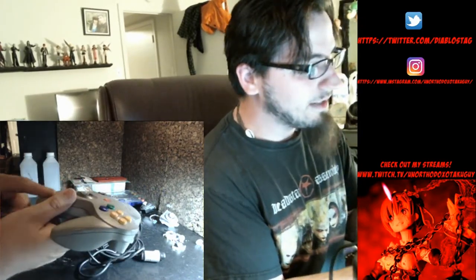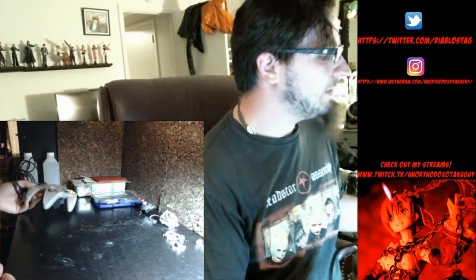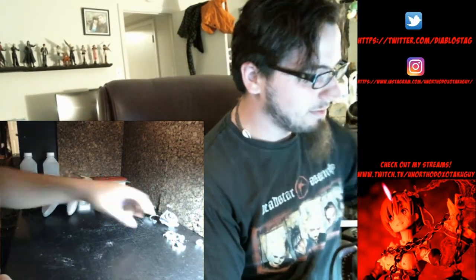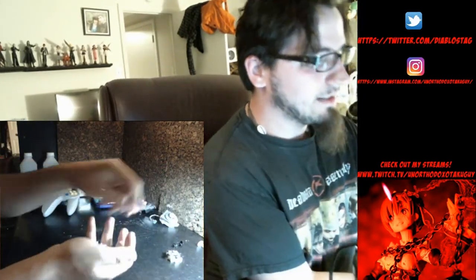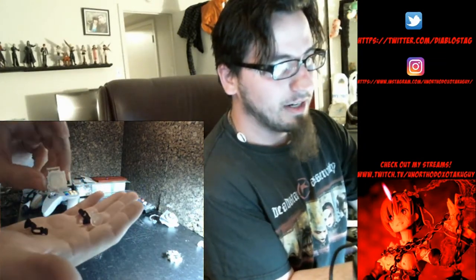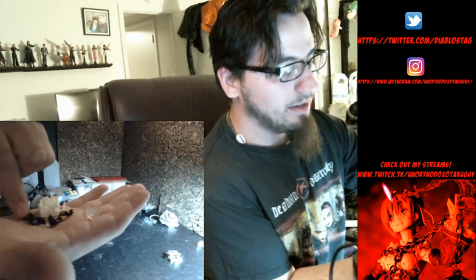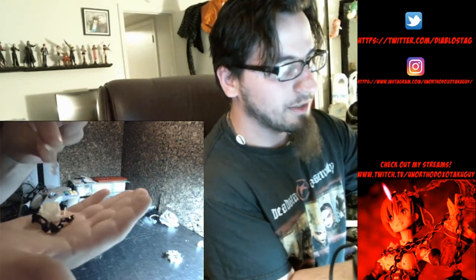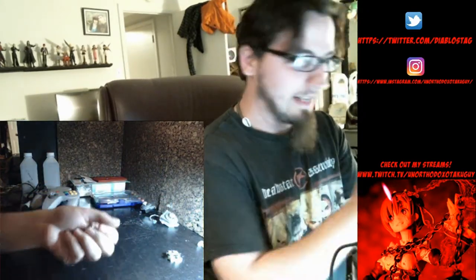And I actually see the residue on this controller that I need to clean off still. This was a controller I picked up for $4 in Goodwill. Had a busted stick in there pretty much. It was all loose and wobbly. Had some extra spare parts, which, again, I ordered from Kitsch Bent, which look like such. Since you're coming in late, Grazy, I can show you this. It's a brand new mechanical bowl. There are two gears. You have the small gear, large gear, and a fresh control stick, all for really cheap, and it fixes your controller to work exactly how it's supposed to.